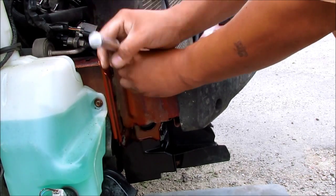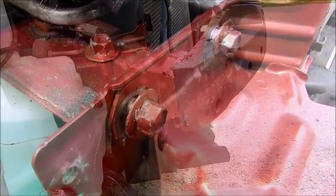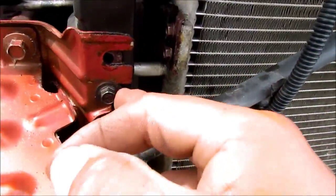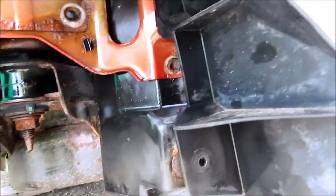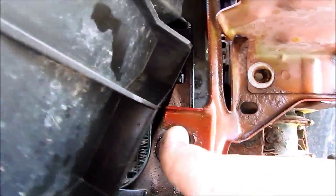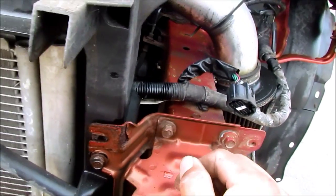I'm just going to keep these two bolts on, take off the other side, get the two bolts on there as well. I've got them loosened up. There's another one down here — that one busted off in order to get to this bolt here to drop the core. There's another one there, another one here — it's already off. There's another one here.